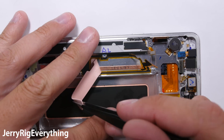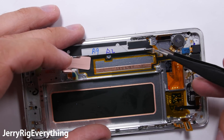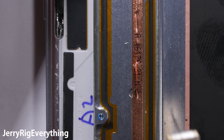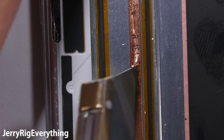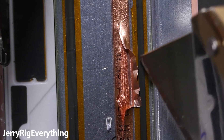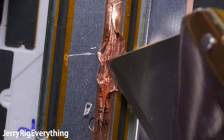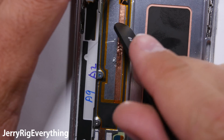I'll talk about the waterproofing abilities of this phone in a future video, so make sure you're subscribed to get the notification for that. Now here is the heat pipe — these are always interesting. Some manufacturers call them liquid cooling, which I think is a bit of a stretch since there's not really any visible liquid inside. It's more of a vapor tube or vapor chamber — it's more fair to call them a heat pipe. The little fibers inside help transfer heat up and down through the pipe as it rests against the processor. We'll fold the copper back down into place, pinch it down, and it's as good as new.